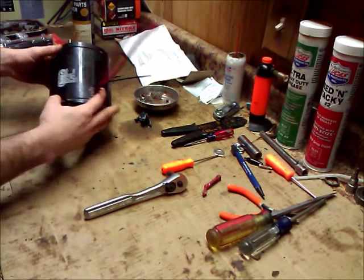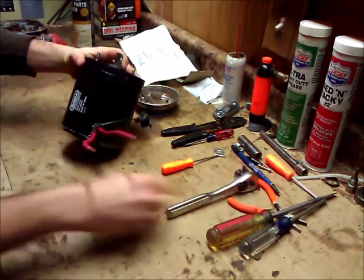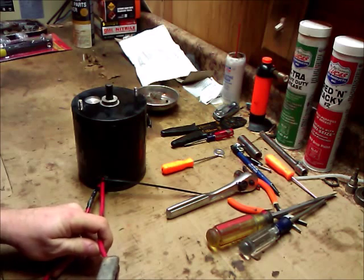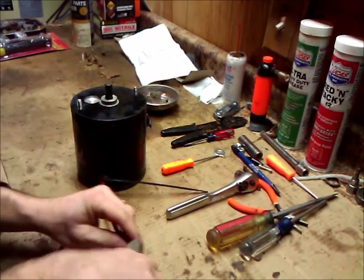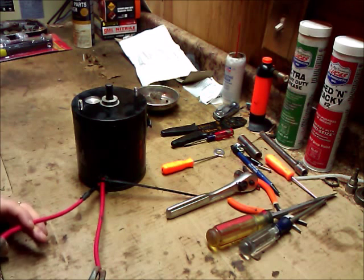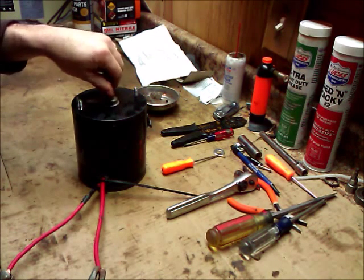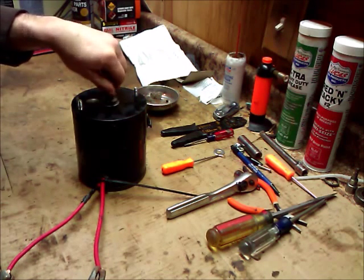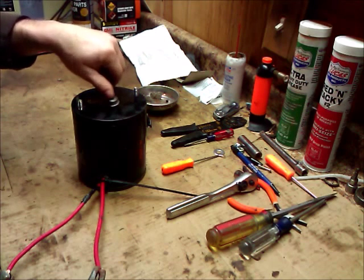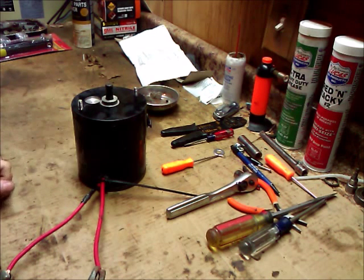So now it's judgment time. I'm going to go ahead and hook this up to my 12-volt power supply — in this case I'm going to use just my battery charger and we're going to see how this goes. I'll take my lead for the positive battery charger and put it right on the positive side, keep these separated, and take my lead for the negative and put it on the negative side of the motor. Incidentally, if you have these hooked up backwards, it'll probably just cause your motor to spin the opposite direction. You can also do this with a jumper box or a battery — any 12-volt power supply. Just don't give it more amperage than the motor is calling for. This motor runs on about 30 amps, so let's turn it on and see what happens.